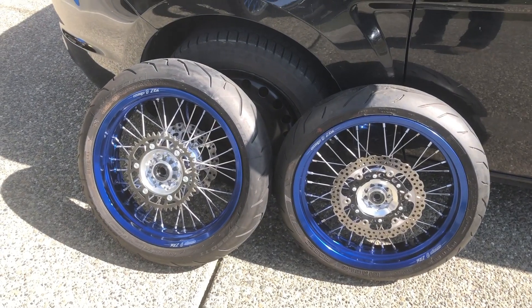One thing I noticed while riding was that the seat height was definitely lower with these 17-inch wheels — it made the bike feel a lot lower. I could almost flat-foot one side no problem, whereas before I could only do a tippy-toe. A couple of things to point out for safety: after your first couple of rides, check your bolts on your front and rear axle, and make sure all your sprocket bolts are tight so the wheels don't fall off while you're riding.